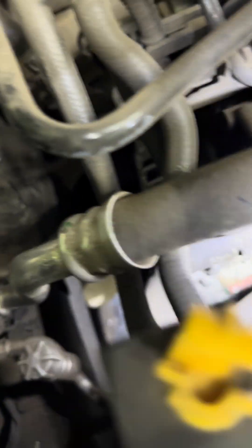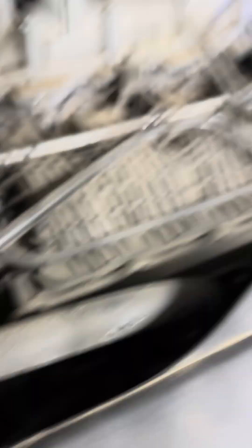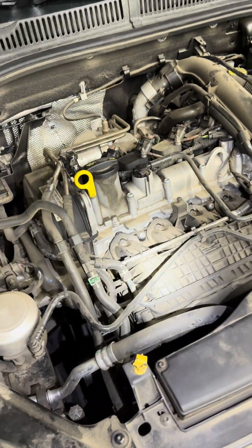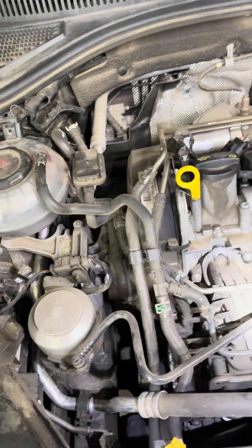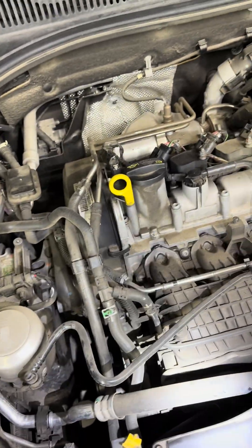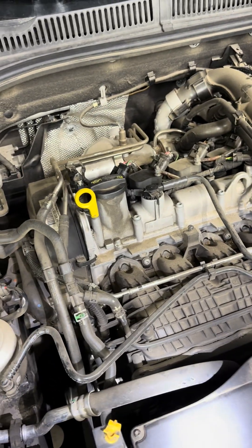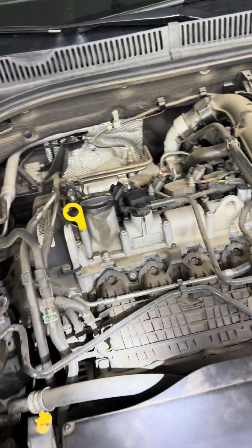You can use a multimeter. On the back side of the alternator there's a black cap — that's where the power goes to from the battery; the wire runs directly there. Test the alternator using the case of the alternator as a ground with your voltmeter. It should be pushing out 13.5 to 14.5 volts. Anything under 13.5 volts indicates a bad alternator.